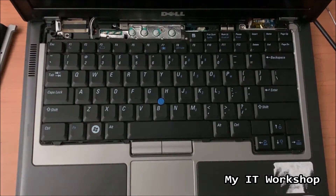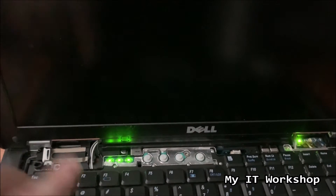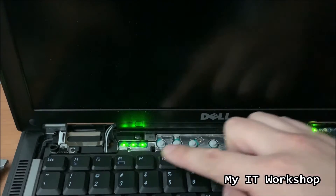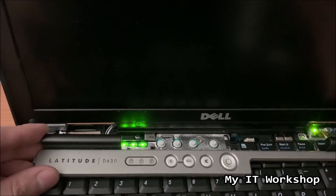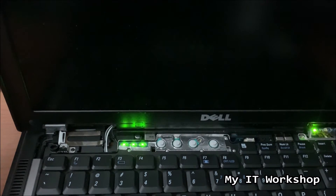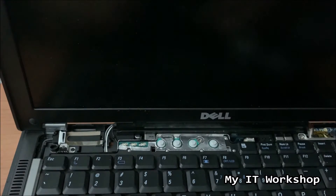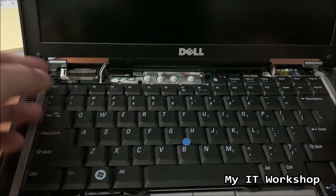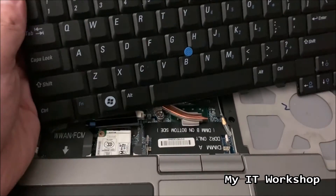I'm going to turn off the lights - the keyboard is not well positioned but that's enough. Allow me a few seconds to adjust my camera. I'm going to turn on the computer and nothing is showing on the screen - there are no sounds, there is nothing. You can see the lights are on and the computer is on, but nothing is showing on the screen because if there is no RAM the computer is not going to turn on, not even the Dell logo. I'm going to bring the cover so you can confirm it's the power button - and it's not going to work.